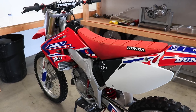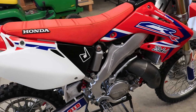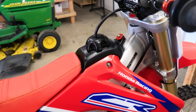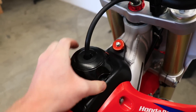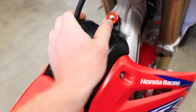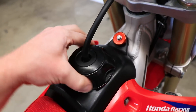I think I've run through pretty much every possible scenario, and now I'm going to figure out what's up with this bike — hopefully I don't have to tear into it too much. The first thing I'm going to look at is the fuel and make sure there's actually gas in the tank. Yep, tank is full, and I know I just mixed that fuel at 32 to 1, so that is not the issue.